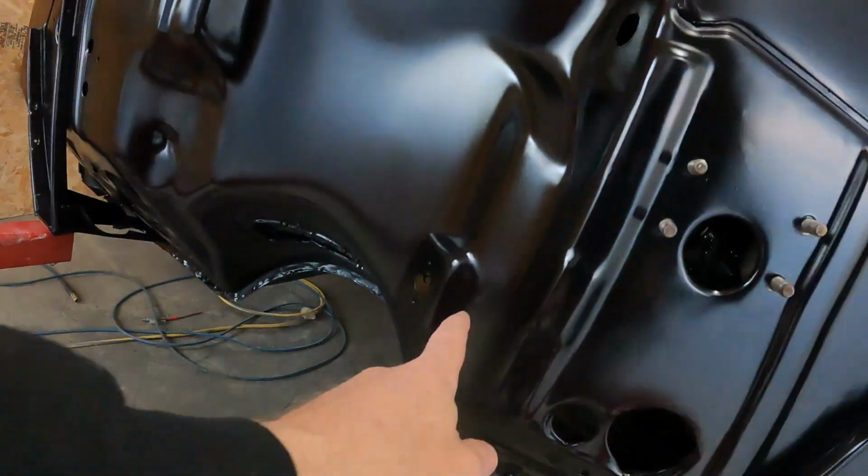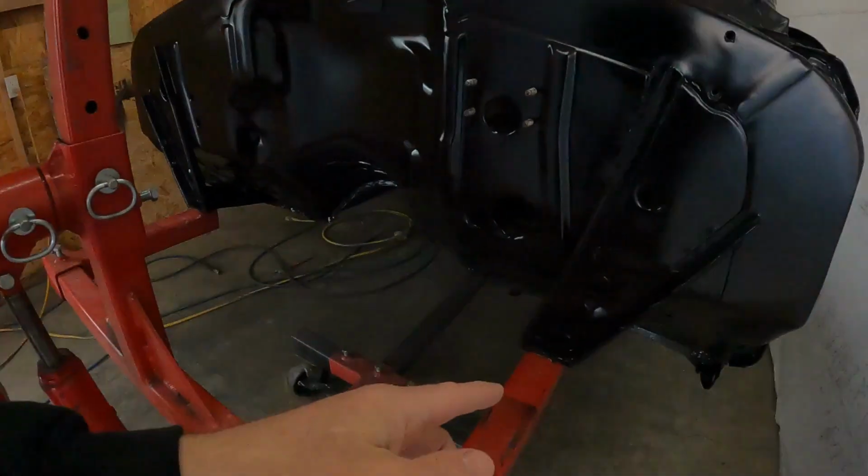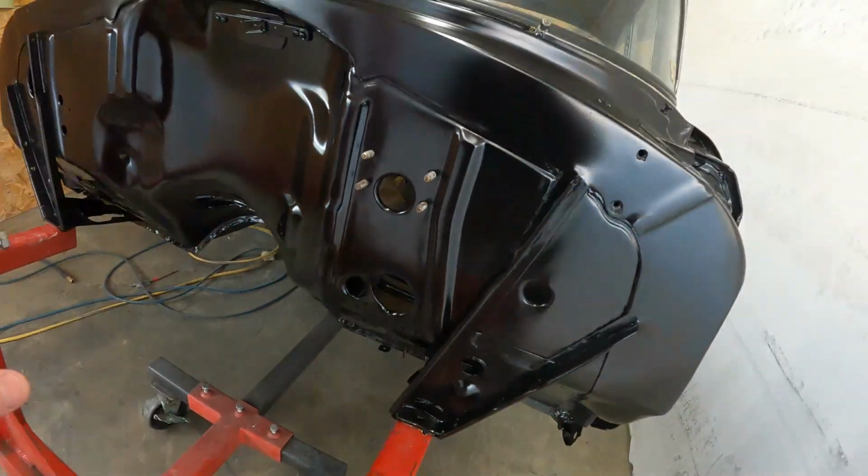I have some imperfections, some stuff I'm not happy with. I got some fisheye stuff there. There's a run over there. So there's a couple spots that I want to fix. And he's like, yep, fix them, sand them out, and then just shoot it again. I don't have to sit here and scrub my fingers, draw in all these little nooks and crannies and crevices. And he says it'll be fine. It'll work. So that's what I'm going to do.